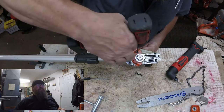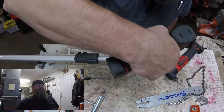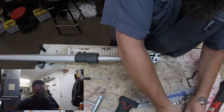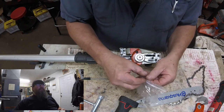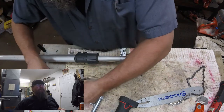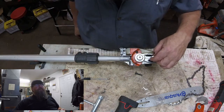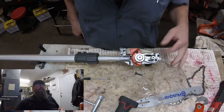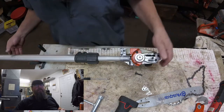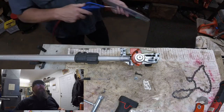The proper spec is snug plus quarter. You know, I never even thought about this nut when I did the repair and did the billing on it, but it looks like a brand new nut. I know it can't be the old nut because it would be hogged out — the threads would be gone. I'm assuming the customer supplied it. If we supplied it, I guess I forgot to bill them for it, but I think we'll be alright.